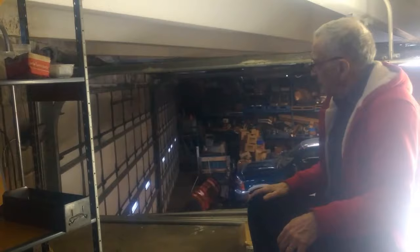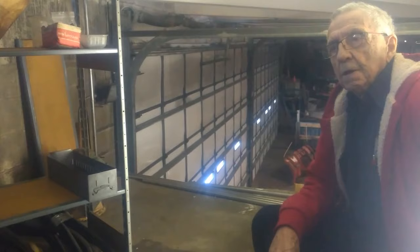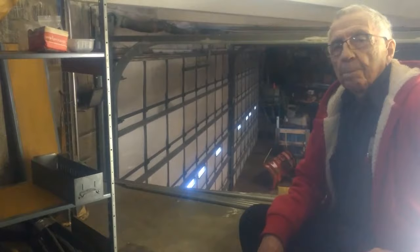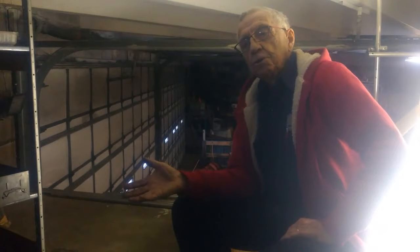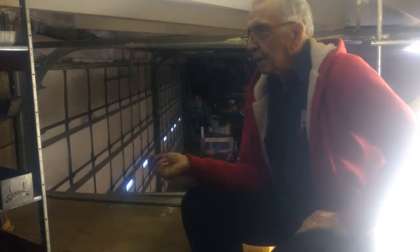These new buses with that DEF diesel fuel additive are giving us no end of grief in the cold weather. In the cold weather, the DEF, diesel emission fluid, mixed into the fuel tank is plugging up the fuel filters. Already we have enough trouble with this corn liquor they call biodiesel. Now the DEF is gelling up the fuel filters. So it means we're going to have to keep these buses warmer in storage. So we're adding another heater here.